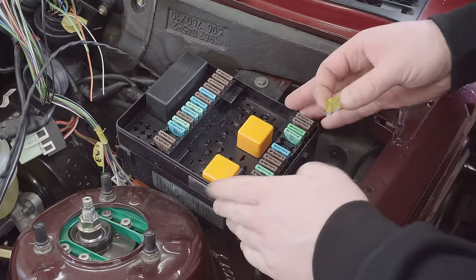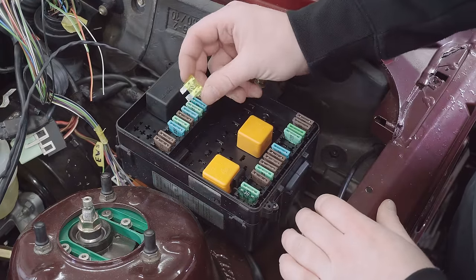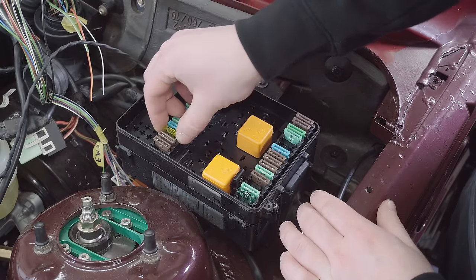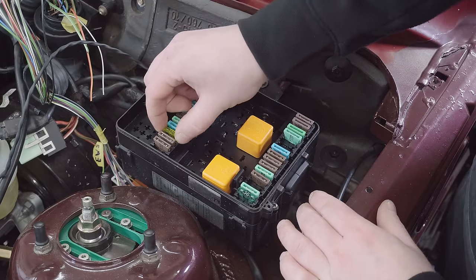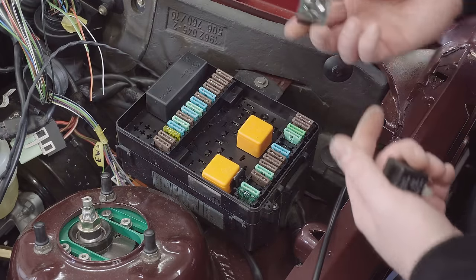Right, with that fastened back together, we need to put into fuse slot 3, which was previously vacant, a 20 amp fuse. And that's the red wire we put in from the bottom, the main power to the fan. And I can stick my relays back in.